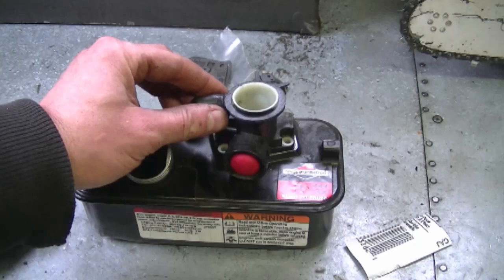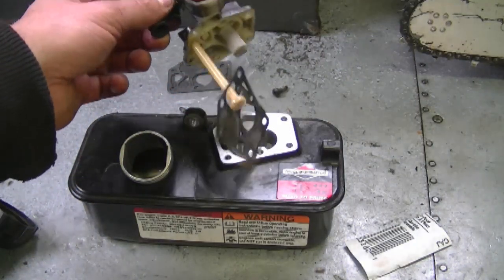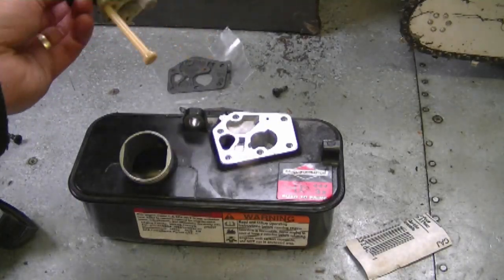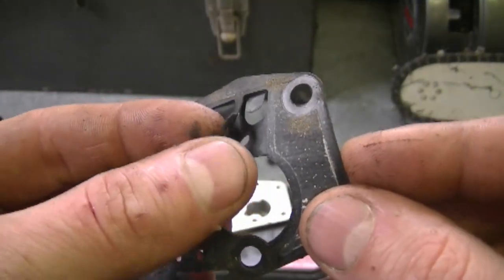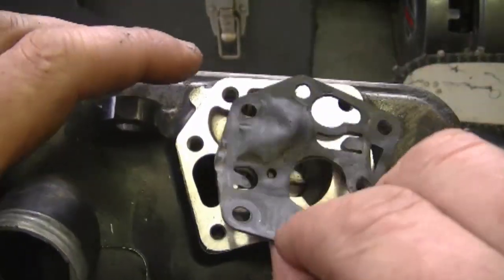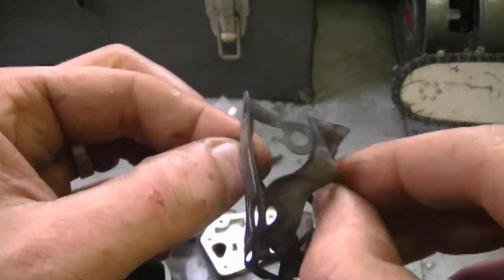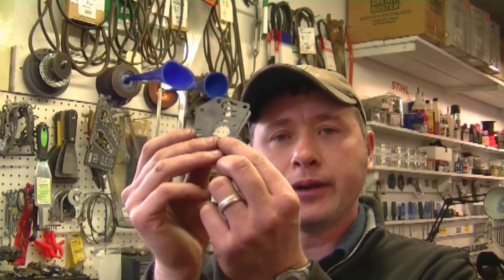I've put the carburetor back on the fuel tank. Now when you pull it out, sometimes the diaphragm will come off and fall, and then you're not sure exactly what the configuration is. If the gasket is still stuck to the diaphragm when you remove it, it's pretty easy to figure out because it will only go on one way. But sometimes the gasket is totally separated from the diaphragm. I've got the new diaphragm and gasket in my hands and I'll show you exactly how it goes back on.